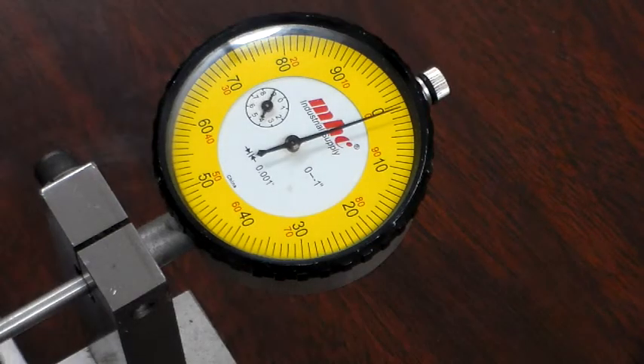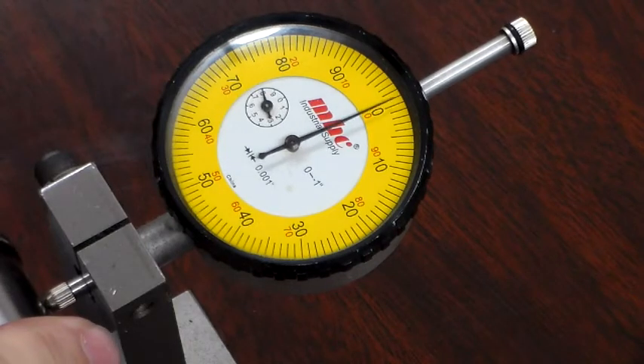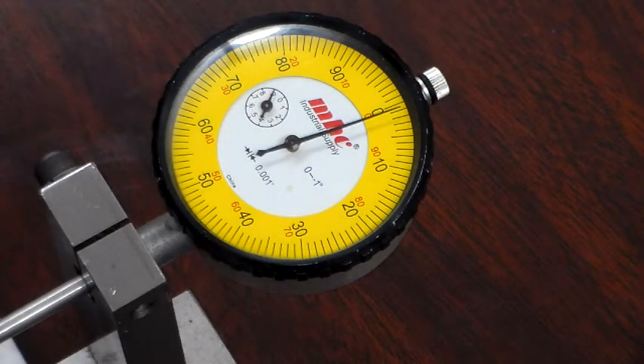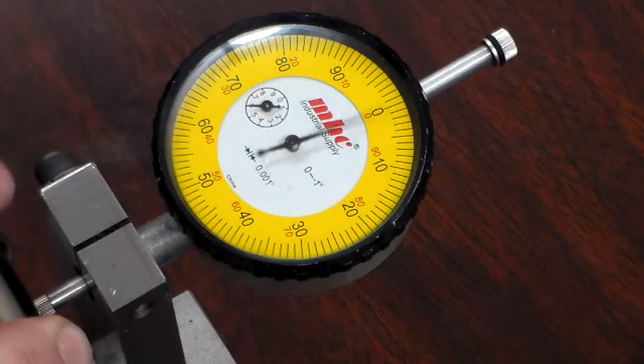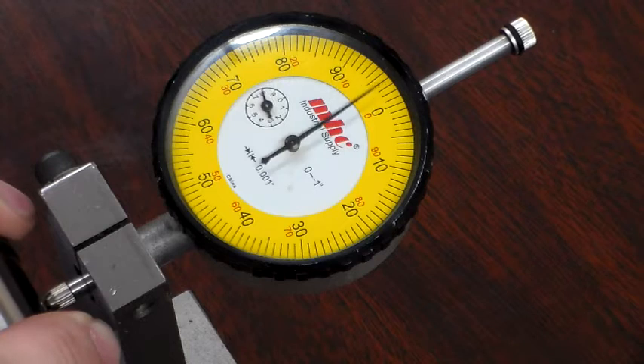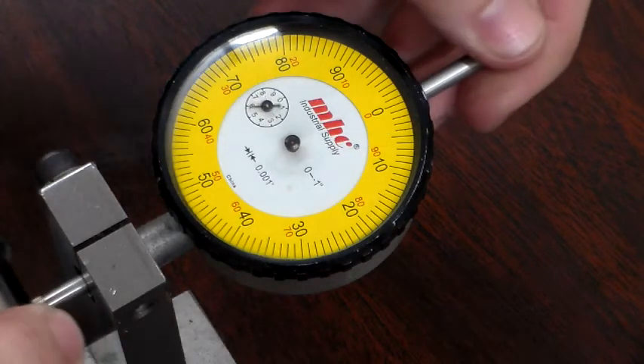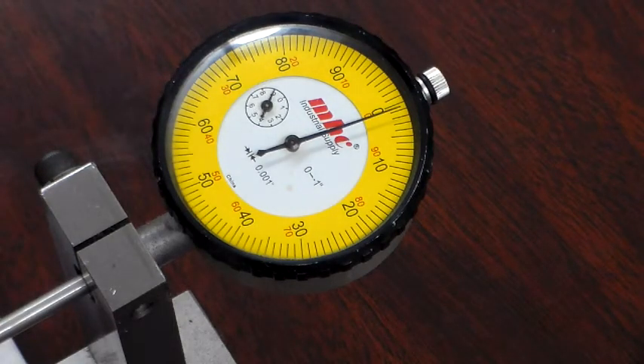So I'm going to show you that one more time. We have a standard — check for our zero — that's 3.123, as we've made clear. Every crank that comes through our door, we go through them and check them by hand. So when we sell you a max stroke, it is genuinely a max stroke — not an assumption, one we've genuinely checked. As you can see, that goes to just before five, which would be 3.133, or a max stroke. All of our cranks are going to fall between 3.131 and 3.133.